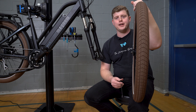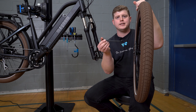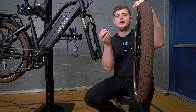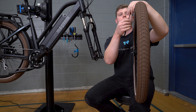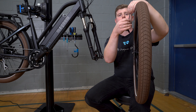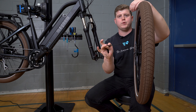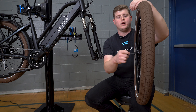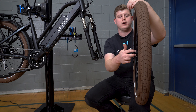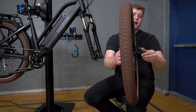The first thing we're going to do for the front end of the bike is install our quick release lever. Your quick release lever has two springs on it — you'll notice that they're both pointing in. What we're going to do is unthread the nut from the other end and take one of those springs with us. We'll take it with the one spring and insert it through the hub. We want the cam switch on the side with your disc brake rotor. Push that through and install the other spring again facing in towards the hub, and the nut.